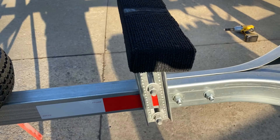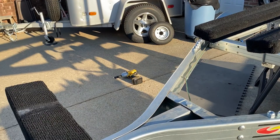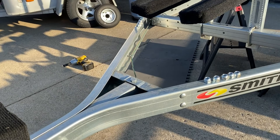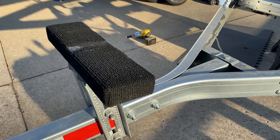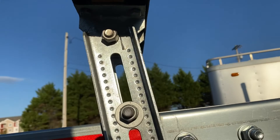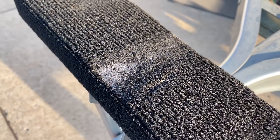Here's something that's made a huge difference for me personally. My boat was doing a lot of bouncing in the front, even though I set the bunks up the way they were supposed to be. There's a lot of weight forward — I've measured the tongue weight and it's right around 80 pounds, pretty heavy for such a little trailer. So I added this bunk made of Southern Yellow Pine with carpet material folded over nice and neat. Got brackets from Academy Sports. You can see the wear mark — that means it works; it's helping support the front end and keeping it from bouncing going down the highway.